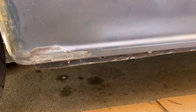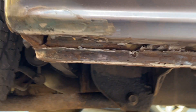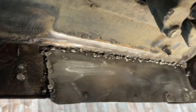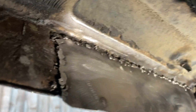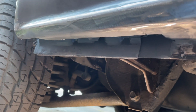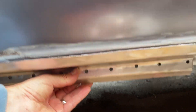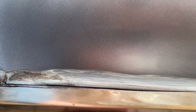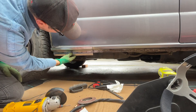My arches are looking pretty rusty, but this external part is what I've had to sort out - it just grew, look at the size of it, it's absolutely huge. I cut all the rusty material out and found more rust going through to the other side of the sill - that all rotted away too. I've replaced that side of the sill as well. I've already fabricated the piece for the outside and I'm being really super cautious about how I weld it in, measuring loads of times just to try to get it right.